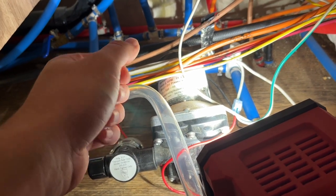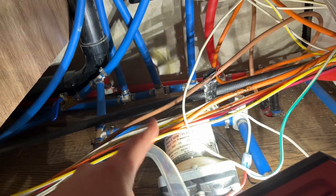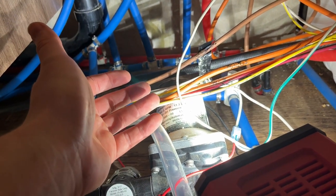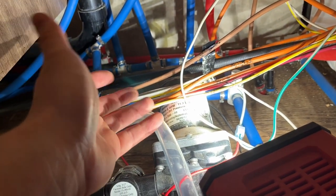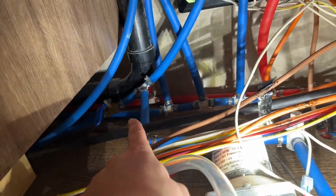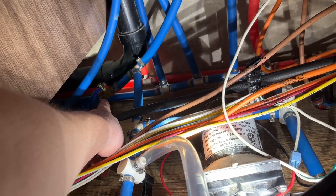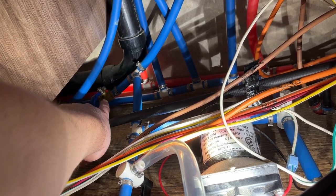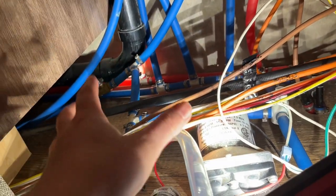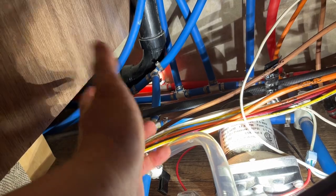It's kind of hard to tell which check valve is failing. So instead of replacing both, and since I've never even used my pump — I've always had city water everywhere I've been — I decided the easiest solution was to add a shutoff valve on the line going to my tank. That's the only way water goes in or out of the tank from this side. It's the simplest solution without replacing a ton of parts, and we had it done in about 10 minutes.